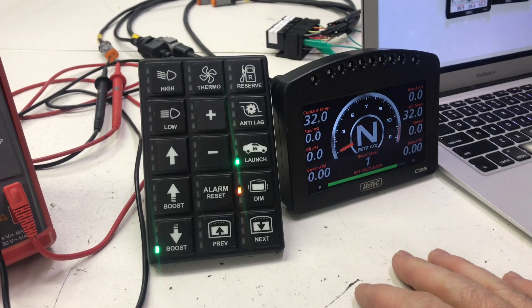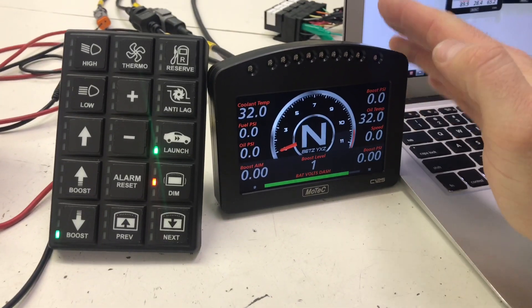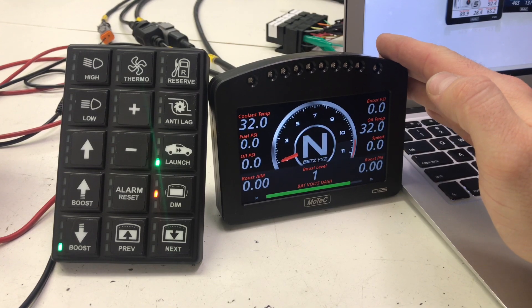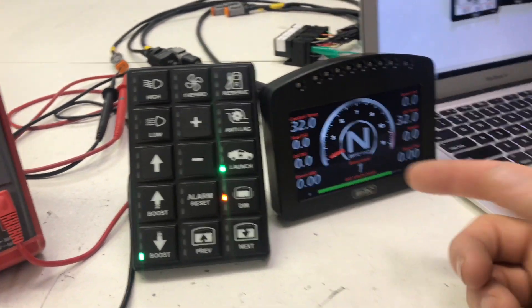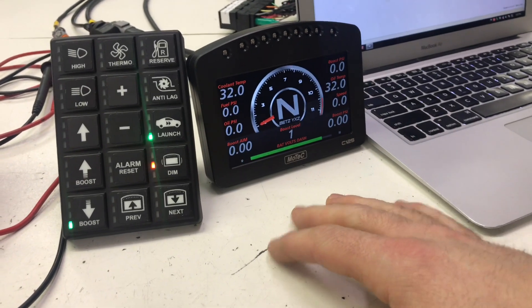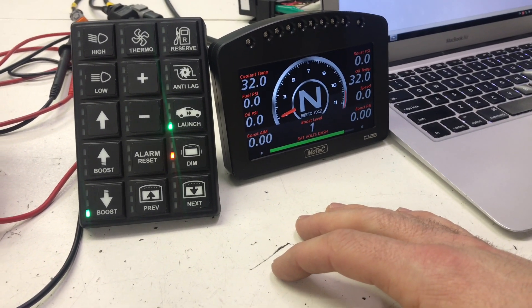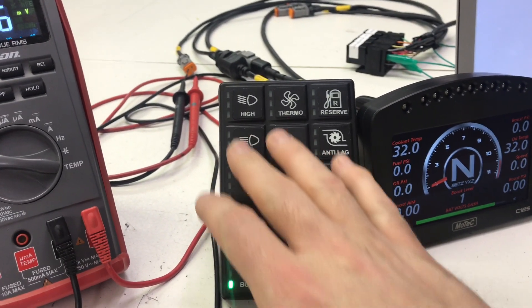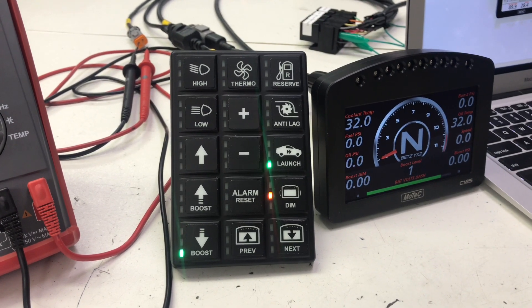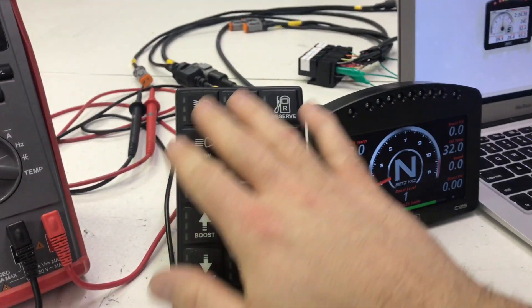No mounting a bunch of switches to turn lights on inside your side-by-side or race car or whatever. If you've got a road car and you have to run a stock ECU, or you're doing circuit stuff and want to set up your MoTeC C125 to do your lap timing, logging, and GPS stuff, you can still use a keypad with it and activate that IO in the dash. You could take in brake pressure, fuel pressure, temperatures for your differential or tire temps, steering angle — log that data. Over here, if you want to run a helmet pump for fresh air, a cool suit, or a drink pump, you can use the keypad to turn those on or off. All that application can be used here, and this is just a template — you build what you want on the template and we program it from there.